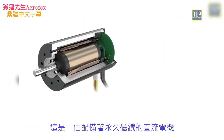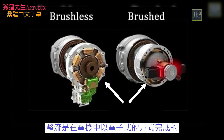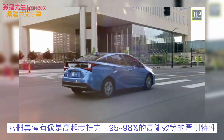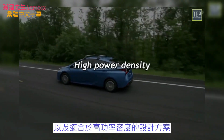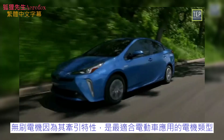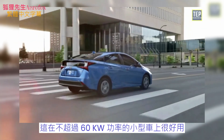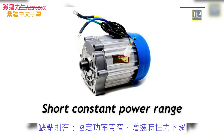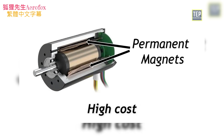The brushless DC motor is a DC motor with permanent magnets. It is called brushless because it does not have a commutator and brush arrangement — commutation is done electronically. Because these motors are maintenance-free, they have traction characteristics like high starting torque and high efficiency of around 95 to 98 percent, and are suitable for high power density design. Brushless motors are the most preferred for EV applications, useful for small cars requiring a maximum of 60 kilowatts. The disadvantages include a short constant power range and high cost due to permanent magnets. The Toyota Prius used a brushless DC motor.